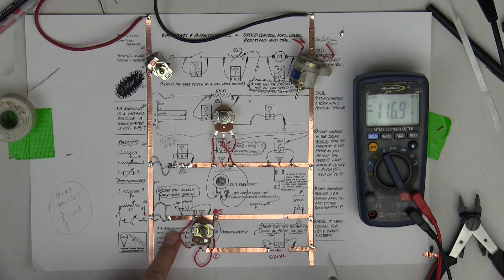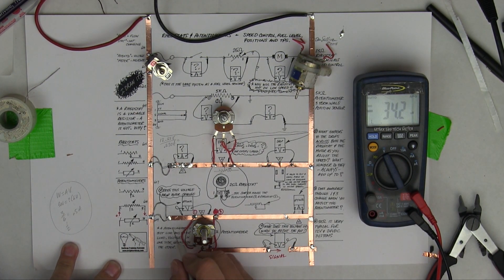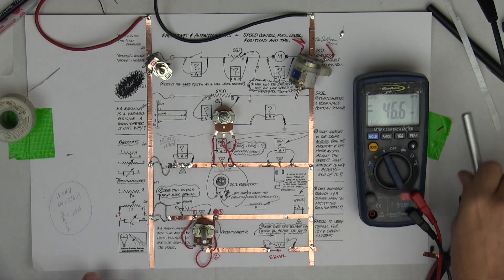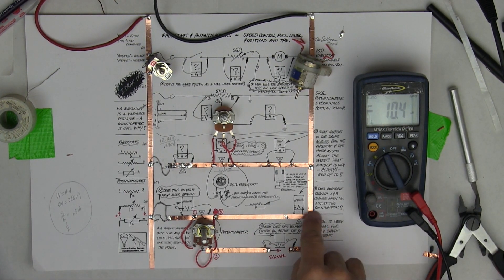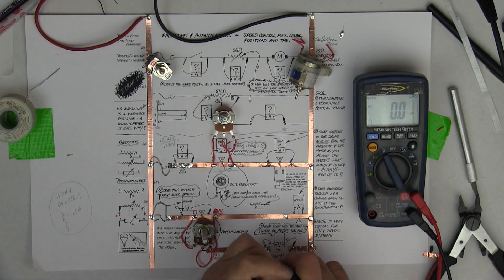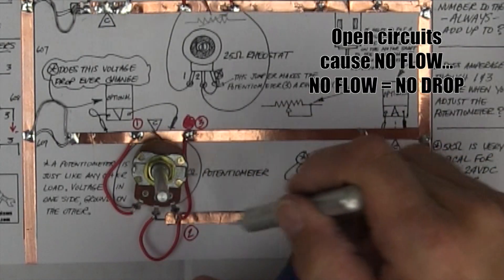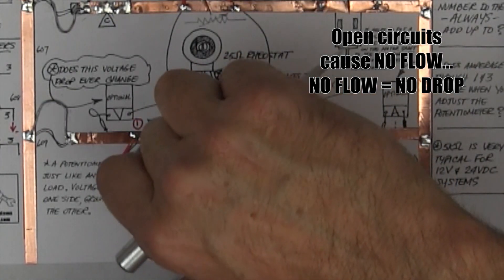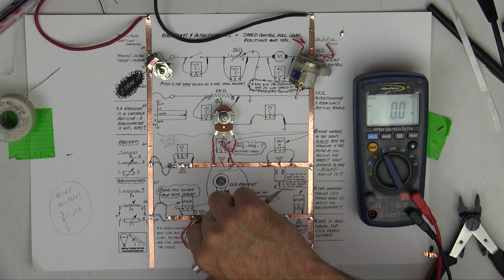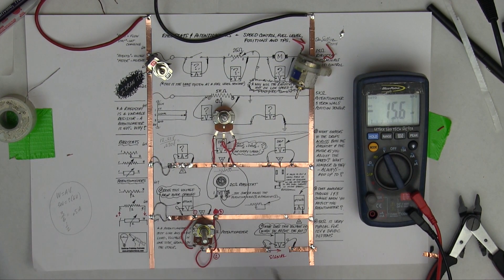There's an open ground and we get full voltage all the time. I'm trying to teach you about some of these fault codes. Now let me open the positive. When I open the positive, I've got zero volts coming all the way through, so I'm reading zero. There's continuity all the way through this device but no current flow. So if voltage never changes, I have no current flow - I'm looking for current flow to make the potentiometer work. Just remember: plus in and ground out, and that's how it works. The 5K is because we just don't want a lot of current.